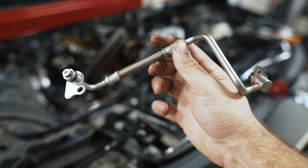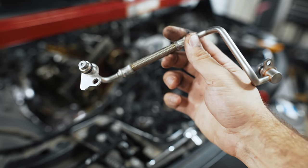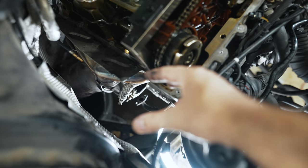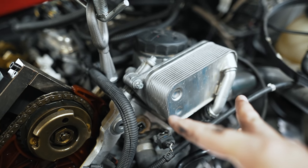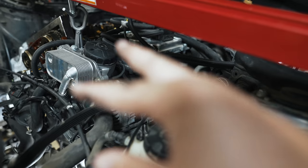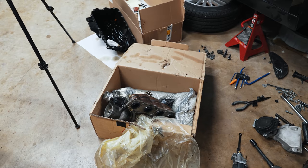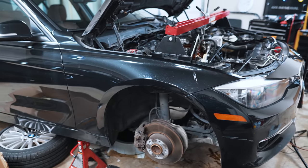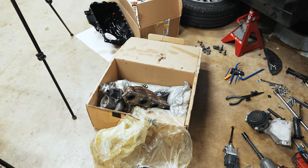Here's the upgraded turbo feed line. I'd have liked to show you how to just update this by itself, but I've got to be mindful of how long I have the car. You basically leave the exhaust manifold on the engine, take off the lines and the V-band clamp that holds the front part, and pull it out to be able to get that turbo feed line installed. I also did the oil filter housing gasket — I pulled the ECU off the intake manifold, removed the intake manifold, moved it over a bit, took out the oil filter housing, changed both seals and put it back together. So just like the title said, this car was mechanically totaled based on the turbo, the timing assembly, the oil pan gasket, the oil filter housing gasket, etc. It doesn't take much to total these cars out and they've got to get in the hands of the DIYers to save them. Regardless, let's get it back on the road.